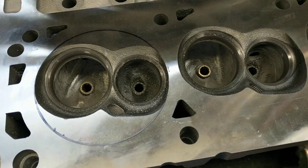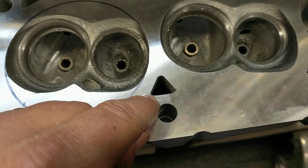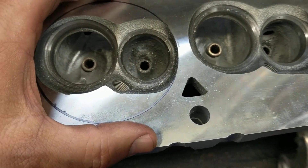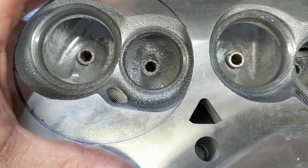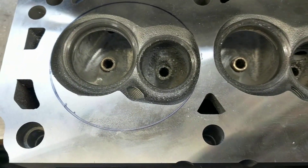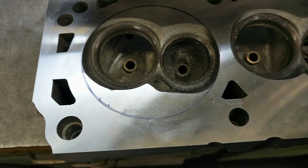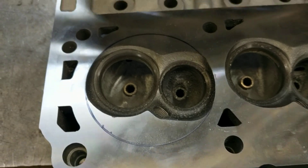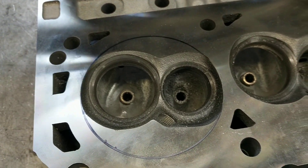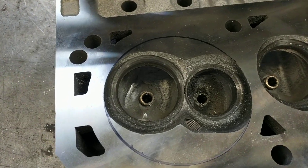One thing that I found on these that's kind of interesting is the outside perimeter of that black line is about where the bore would be when these are mounted on a 4.0 stock 302 block, which is what Pirate's going to run. He's going to have an Explorer short block, Anderson N61 cam, and he's going to run a TFSR long runner upper. I suggested he get a box, but I don't know if he's found one yet.